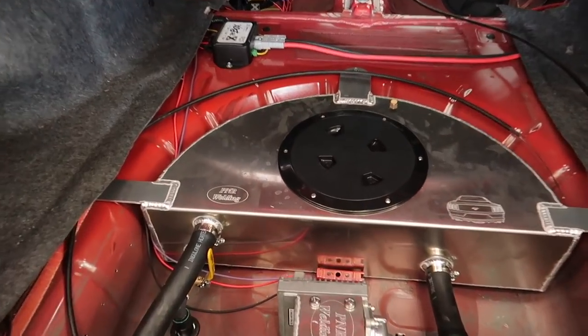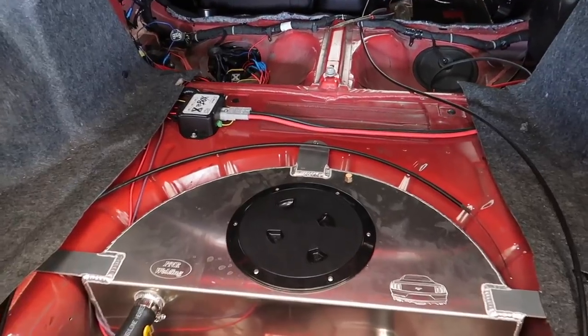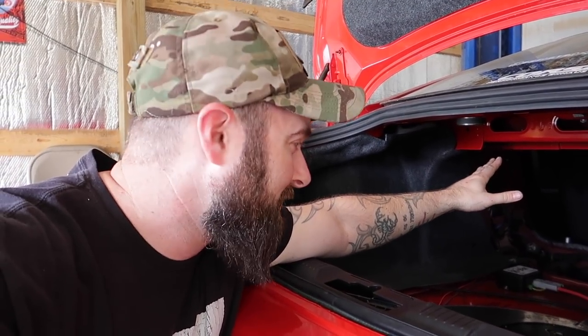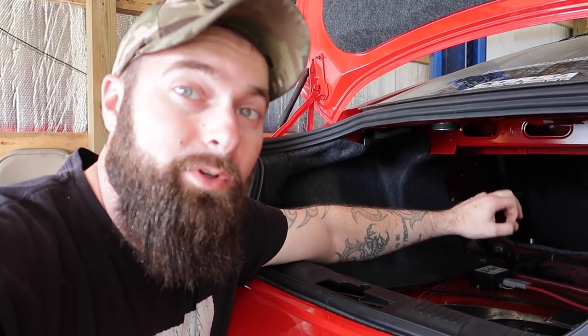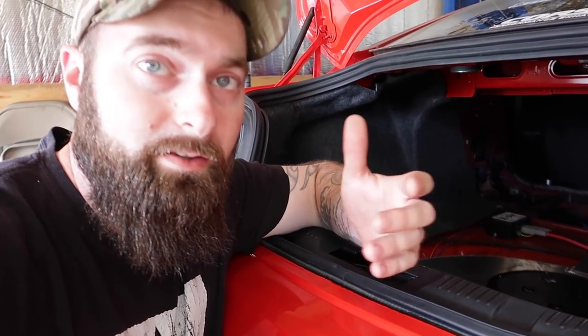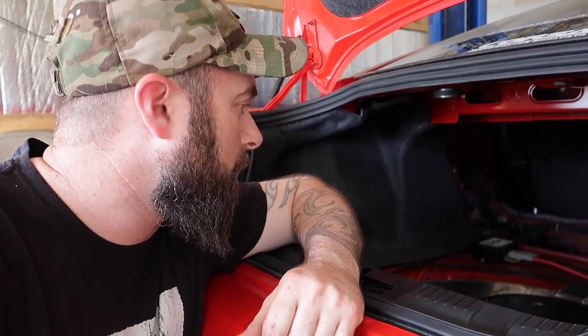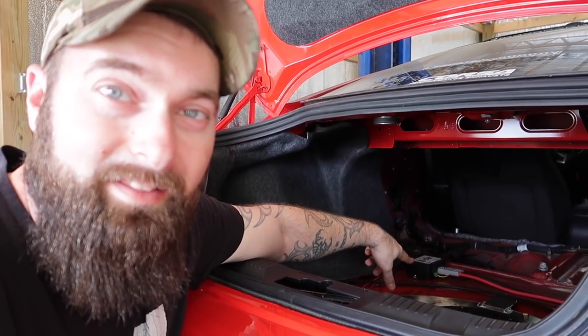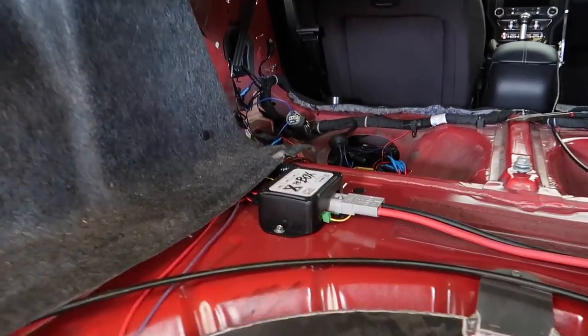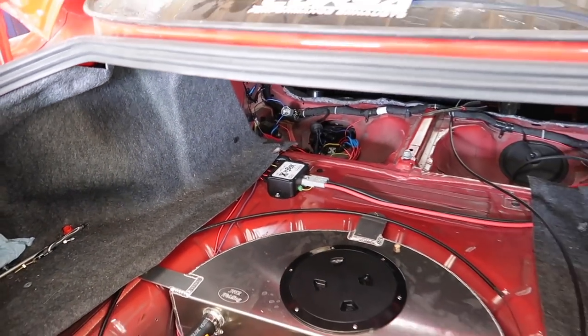I'm going to clean up the wires and make them a little bit nicer. Everything is just now getting finished. We have the new box from Lethal Performance — what the box does is, if you order a Lethal Performance fuel system, which this car has, it makes it really plug-and-play, almost like a VMP style. The pigtail connects — it makes it really kind of dummy-proof to install a return style fuel system in your garage. We had the relays before; they worked okay, but this is a big improvement. It's got these little LED lights that show if your pumps are working, so I decided to mount it in the trunk where I can pop it and come in here to see the lights right in front of that green connector. Makes it pretty easy to troubleshoot.